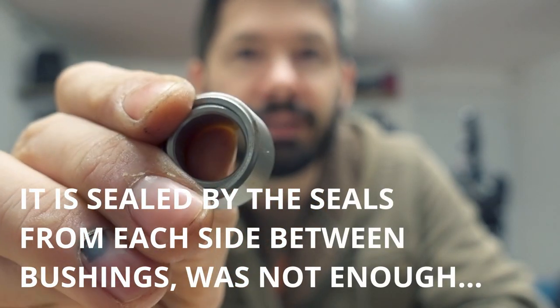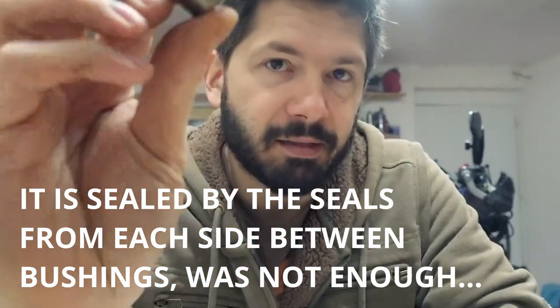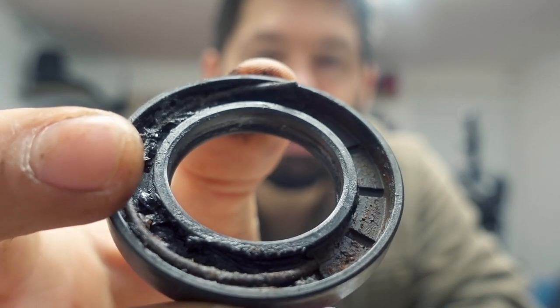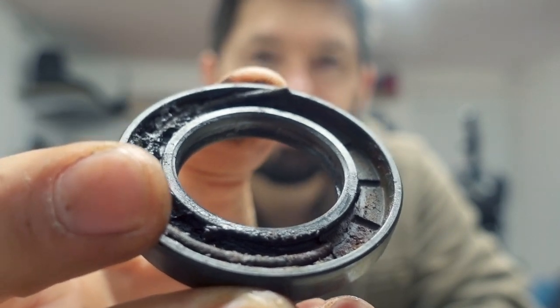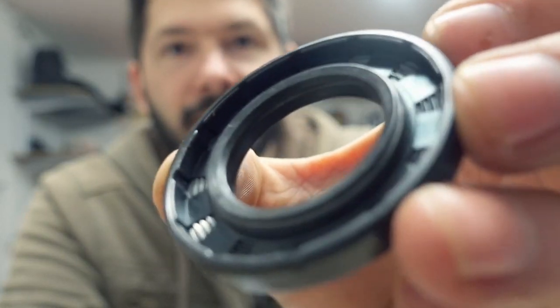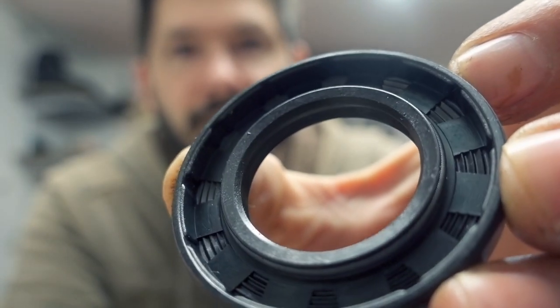In the suspension, the bearings are not sealed, so you have to check them quite often — mine was a lot of pain for me. The seals are what keep the bearing safe. They wear out not quickly, but they do wear out much quicker than the bearings themselves. Here from the rear wheel, this is the old seal — when it's not sealing properly, water and dirt get in. You can see the little spring inside is broken and rusted. That is not how it should look; it needs to look like this, with a shiny spring and a clean seal.